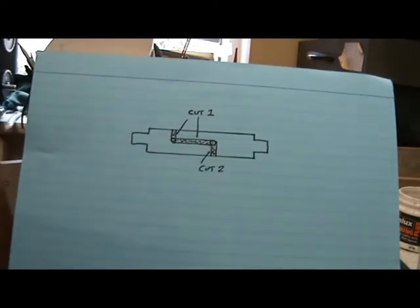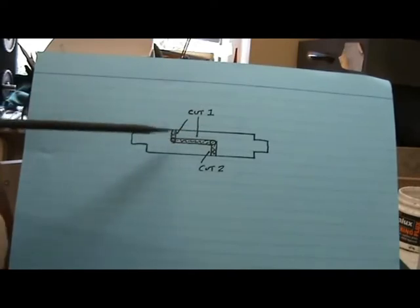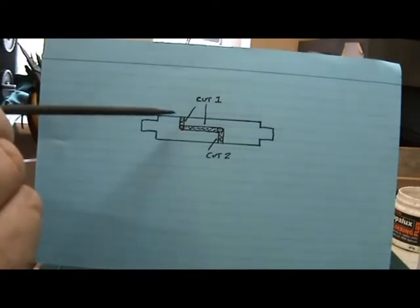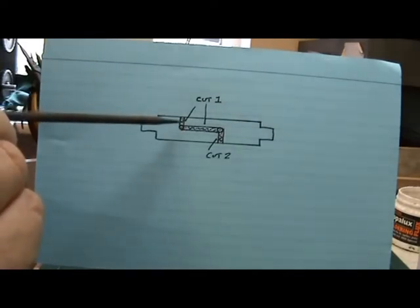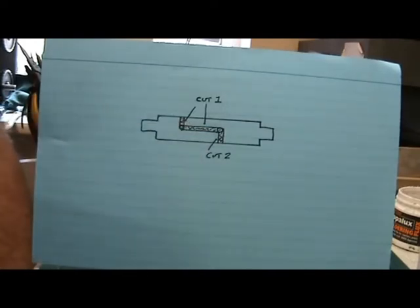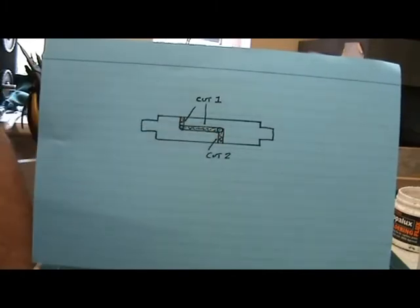At that point, stop — if you go any further your axle will fall apart, and that's not what we want. Having cut the axle down here and across here, we've now got an L-shaped cut, which we then need to clean up with our wet and dry, making sure there are no burrs or any little bits of metal swarf in this gap.